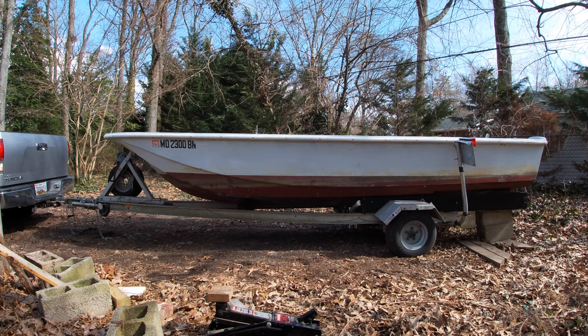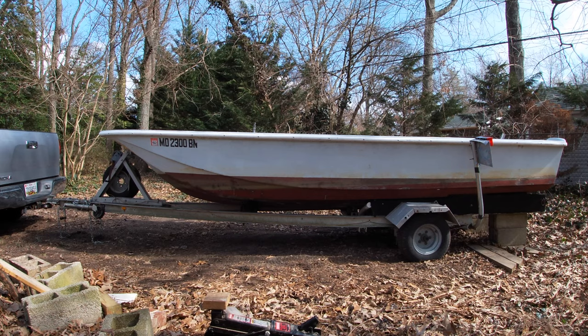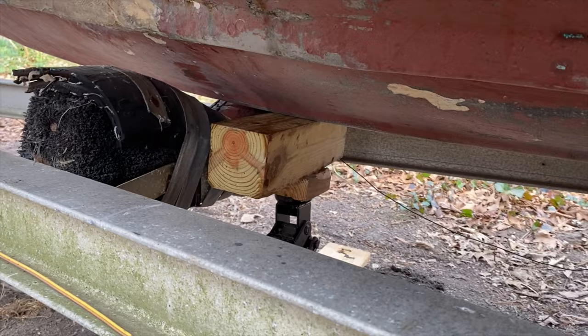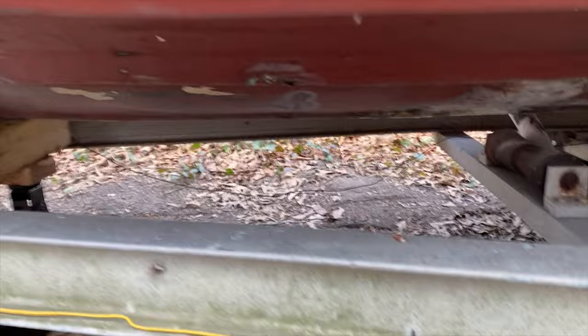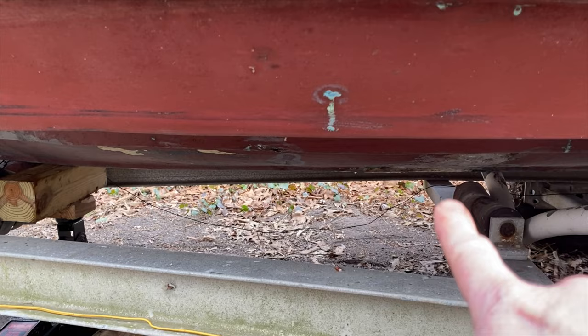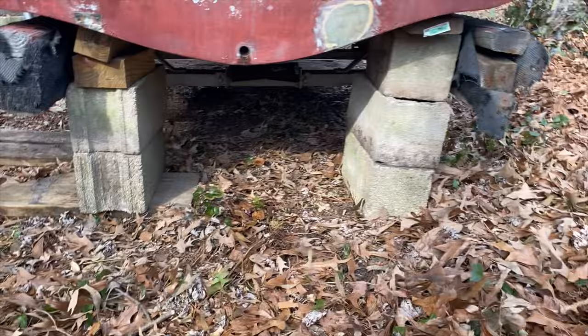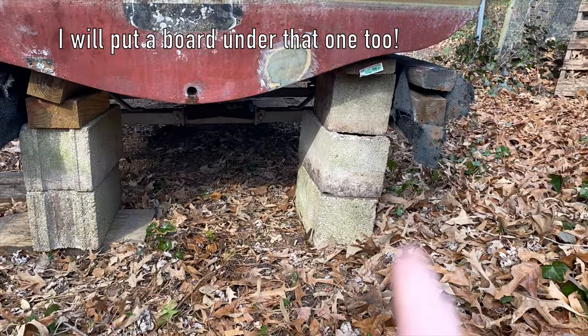Having the back jacked up and the front sitting on the pad of the trailer, I was not able to pull the trailer forward — it wanted to stay with the trailer. What I realized I had to do was jack up the front. I've jacked up the front and the jack has the boat lifted up, but I'll only be able to go so far before I have to rearrange everything. It's held up with two things in the back and the jack at the front, and this is looking kind of precarious, but the boat is actually off the trailer.